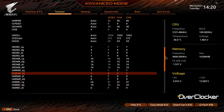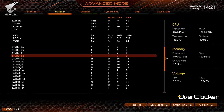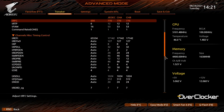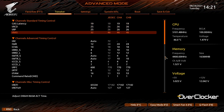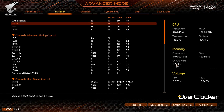Other settings are standard. Some won't go lower than 7; the different-rank setting isn't relevant since I'm using single-rank memory. The different-DIMM setting is important though — 7 is the lowest you can get it; trying 6 actually made performance worse. So 7-4-6-6 is what to use there. Outside of dialing in your primary timings, you should achieve the performance I showed with the tuned 4400 setting. For secondary and tertiary timings, I don't think it gets much better than this.